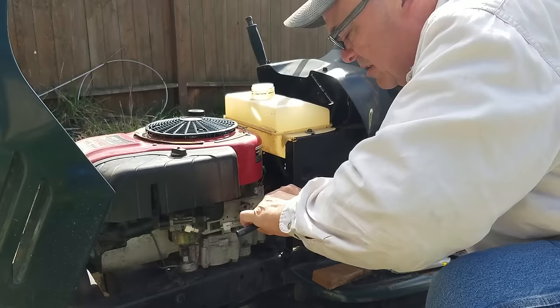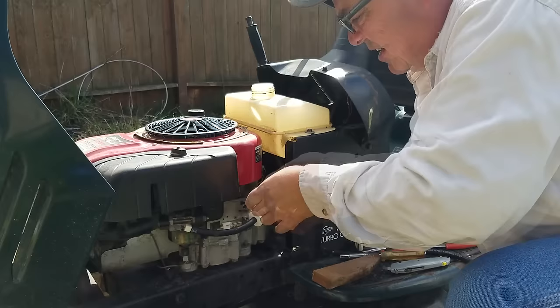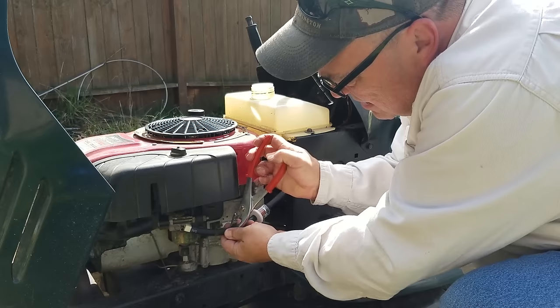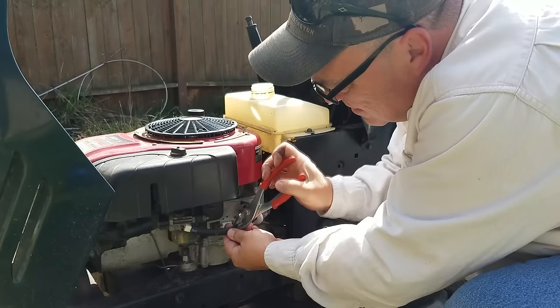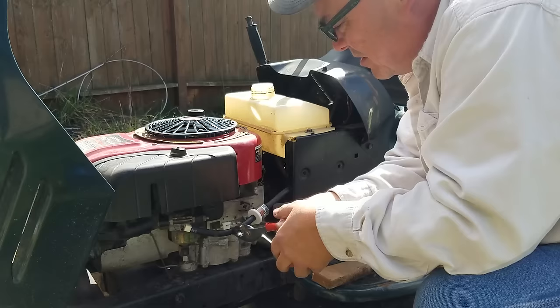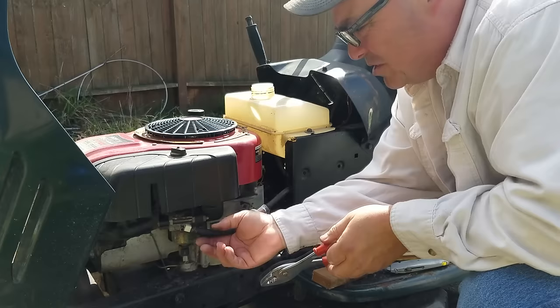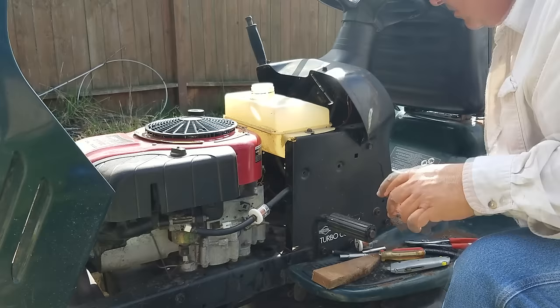I've seen some people put a little bit of motor oil on the fitting to help slide the hose on, but motor oil will actually eat the rubber, so you don't really want that. Now we've got a good clean connection — it's not too tight, it won't crimp up, and it's not going to sag. You don't want too much line — that makes for a sloppy job. Let's get these clamps secured. This clamp is a little buggered up, but it'll hold and it'll work.